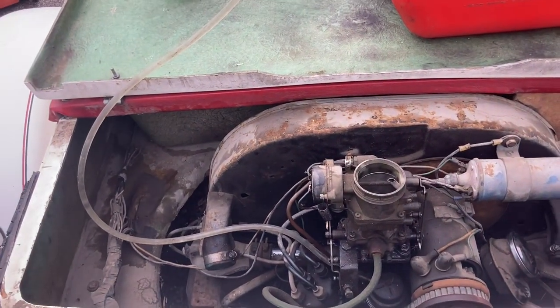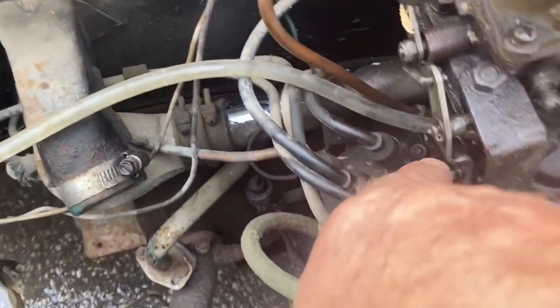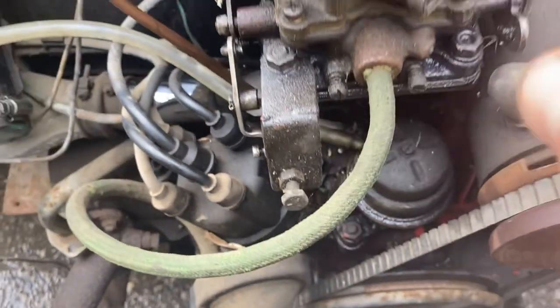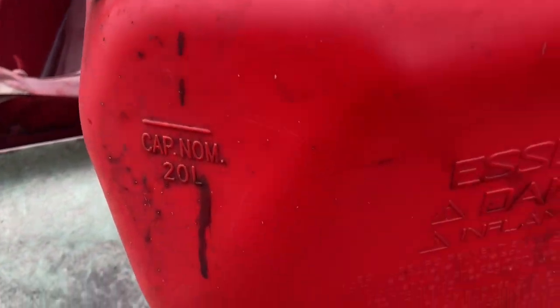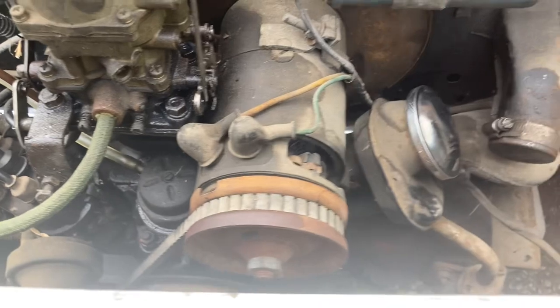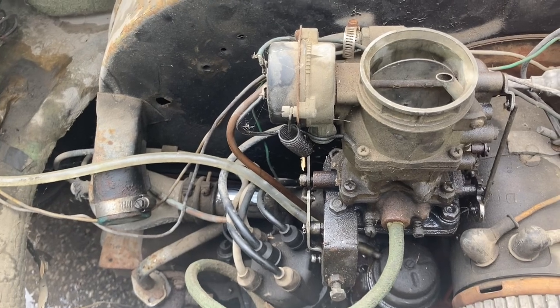In between rain clouds, here's what I've done: I got a bottle with a fine tip on it, hooked it onto this fuel line here, and squeezed it till I saw fuel going down into the fuel pump right here. So now I'm sort of priming the pump. Then once I filled that line with fuel, dropped it in a tank of fuel, put it a little bit higher than the engine — so gravity's our friend. Checked the oil, cranked it over, and got it to run.